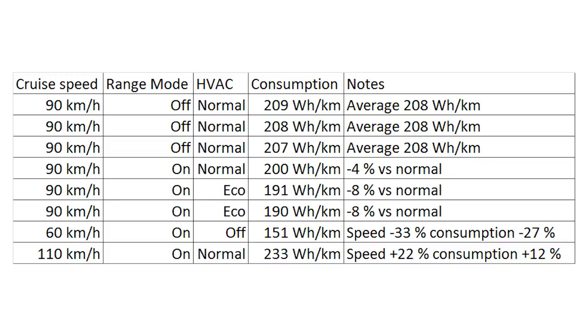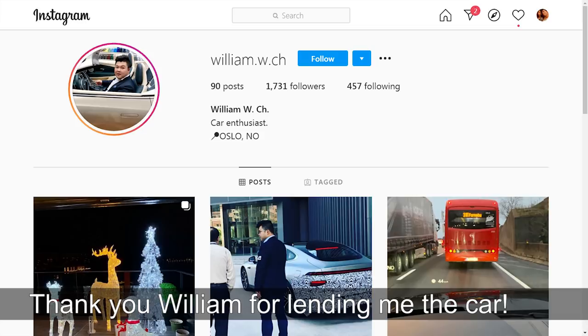So if you look at the numbers, it seems like range mode does help, but not that much. But Eco mode on the HVAC also helps. I guess a combination — well, by default, if you enable range mode it will also go into Eco mode on the HVAC. So those two together help actually quite a lot. And then if you drive slow it helps even more, and if you drive faster you use more energy. One test I haven't tried — since it's not my car — is to drive behind a truck. I bet if you drive behind a truck at 85 kilometers per hour, you can probably go down to around 170 watts per kilometer, which gets you close to 500 kilometer range. If you have to, then you can draft — you'd better have some kind of PPF on your hood though. Anyway, I think that's going to be it for now. I hope you guys enjoyed this video. As always, thank you for watching and talk to you later.